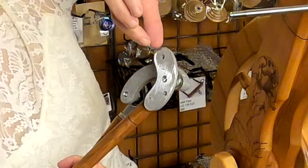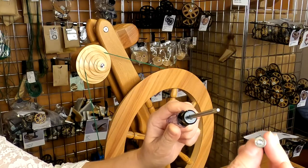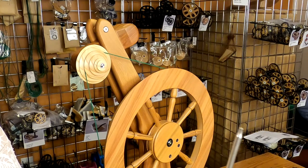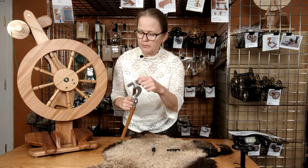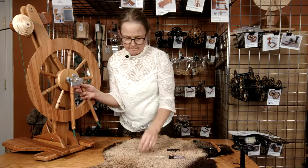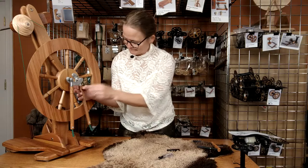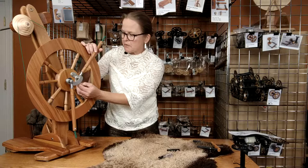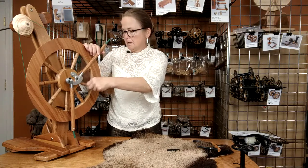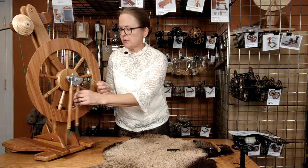Now it's time to install the crank assembly. There are three holes in your crank assembly that line up with the three holes on your drive wheel. The screws have a different kind of head called a positive drive head, and you do need a special screwdriver for that — it's not a Phillips head. They line up nicely; there's a pattern where two are close together and one is off on its own. Just move the wheel and parts around to make it easy to find the holes and thread the screws in. I've seen videos where people remove these pieces when changing the drive band, but I remove the joiners instead.